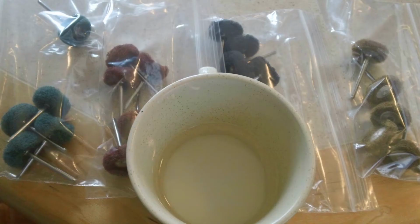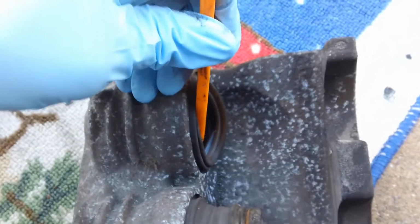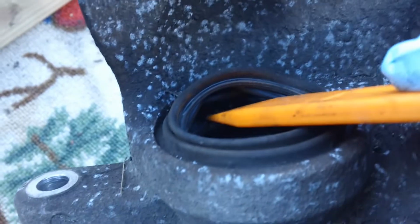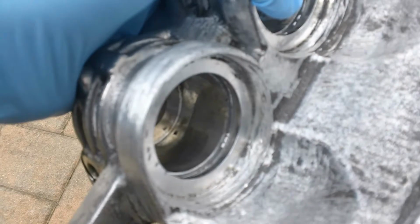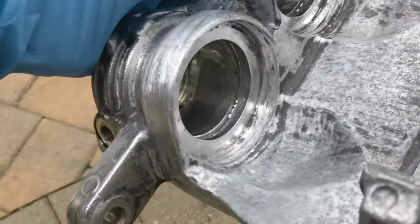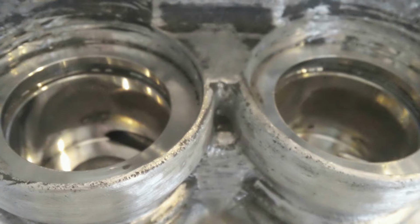Okay, so I wanted to try an alternative method with a plastic pry bar, and if you can do that, that's great. I just wanted to show in reference to where that seal fits and the lower O-ring there. So I used a variety of different abrasive style buffers on the inside to clean up, and that's before cleaning, and inside the bore area, trying to get some of that debris out of there, and also that's after cleaning the square O-ring area for the brake O-ring.